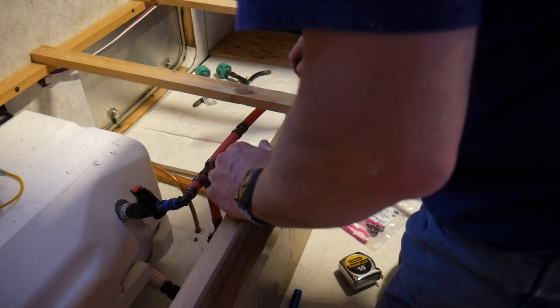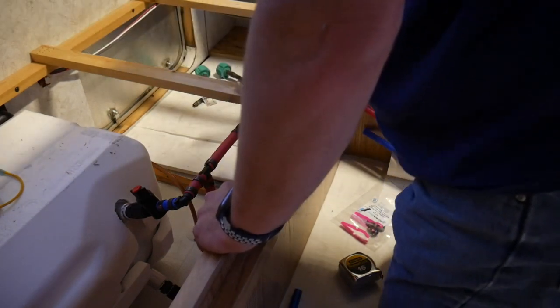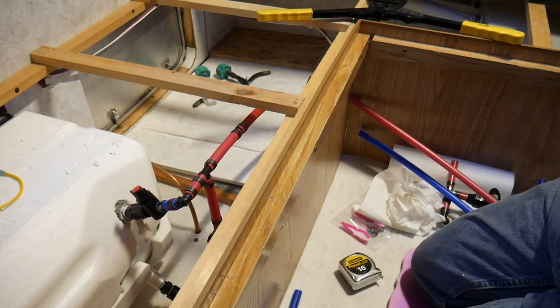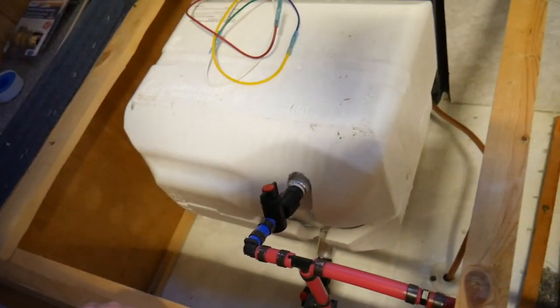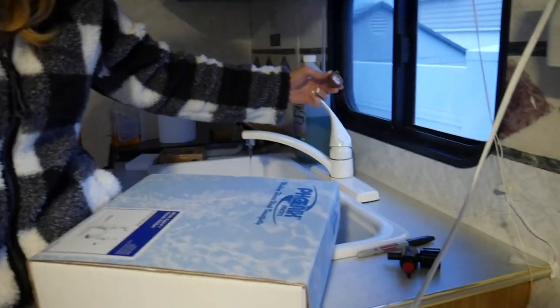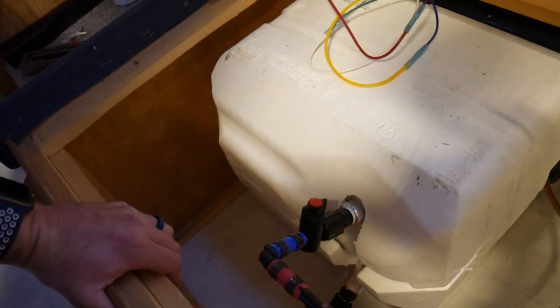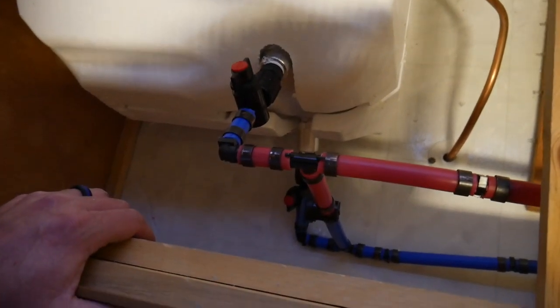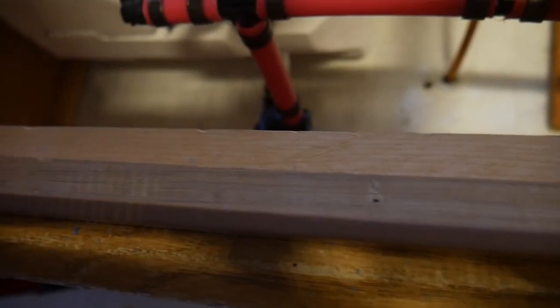All those are cracked — should be able to crank up our water. Let's hit the pump and see what happens. We have water pressure! You can hear water going into the water heater, it's filling it. Oh, hold up — we got a leak. Turn it off! I've got a little puddle building right there. I probably didn't get one of my fittings crimped tight enough.